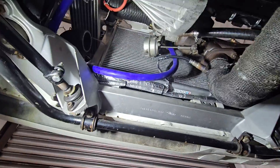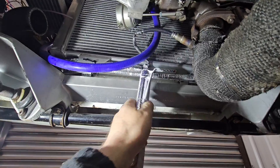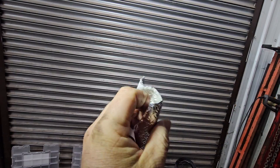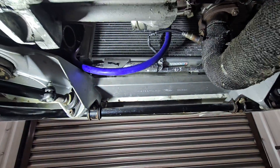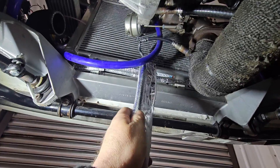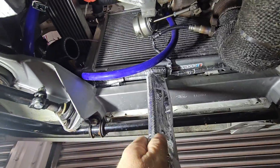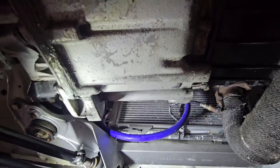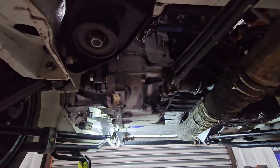Essentially, I've put the boost pipes back on. The fan wiring and the lambda wiring I've wrapped with a wraparound heat protector — it's fairly inexpensive, just a sticky-back foil, available from Hilltop. These do suffer with quite a lot of heat under here, so hopefully this will look after the wiring as well as it can. The actual lambda sensor cable itself is already heat protected, but I've run some extra fan wiring in the same piece. Boost pipes are back on and we are ready to rock — just got to connect a few bits and pieces upstairs.